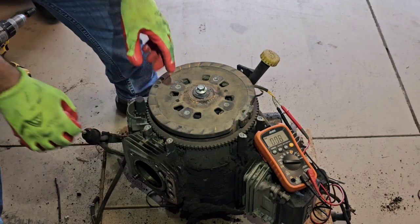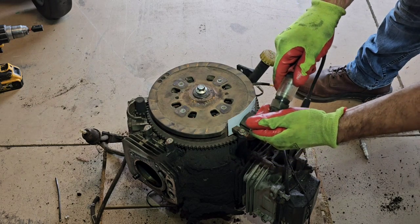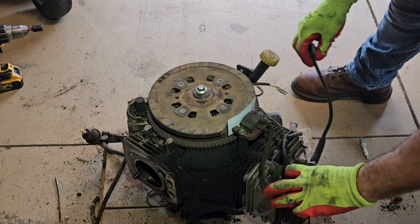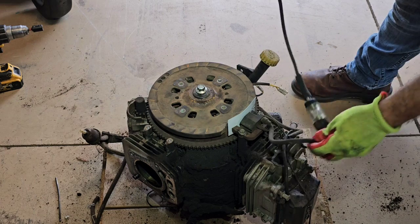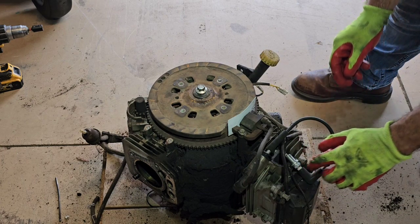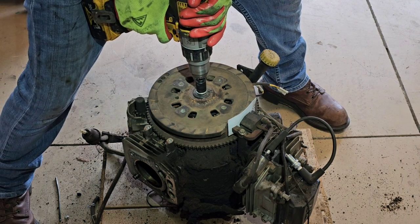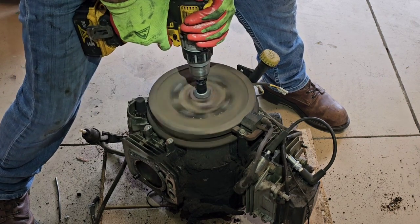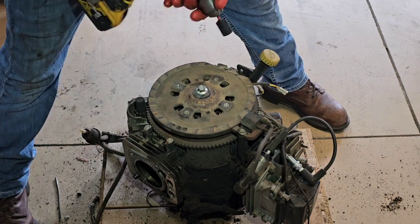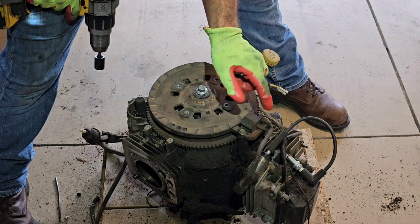I've installed one coil — you'll see there's a business card between the coil and the magnet that's mounted on the outside edge of the flywheel. I'm installing a coil tester and also the spark plug, just to see if you guys could pick up the spark. It has to be grounded against the block of the motor for the spark plug to work. Unfortunately, the plug wire was blocking the view of the coil tester, but you can see some orange light right here when I spin it, because there's another magnet on the flywheel — the copper coils inside are why it's called an ignition coil.